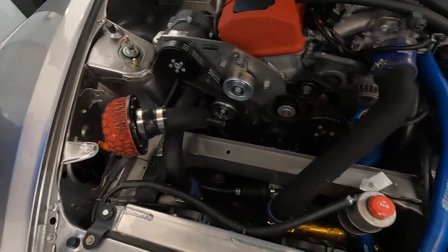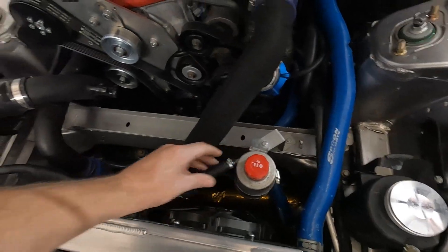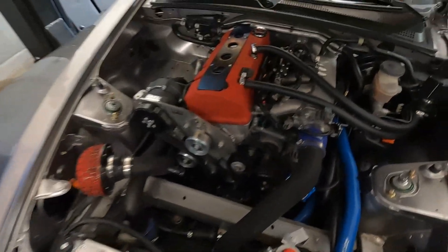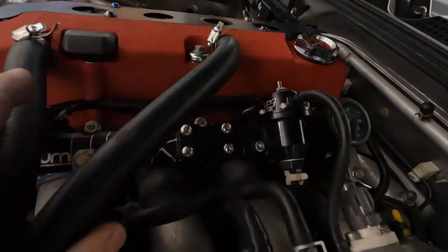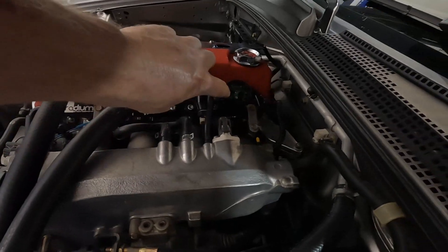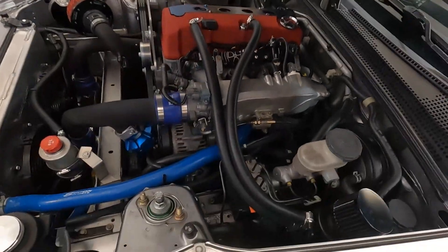Just paying attention and writing a list. This one's okay — that works. This is obviously for the system but maybe it can sit over here. He said he had a leak over here and it does look a little wet right here. Doesn't look too bad — it's just wet. We'll check the O-ring and the seal on this. There's no pressure in here right now and the pressure dropped off, so there could be a leak in that fuel system.